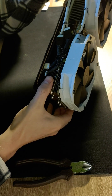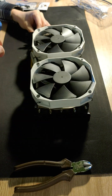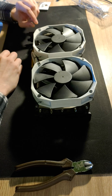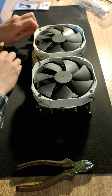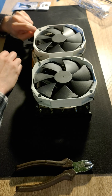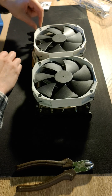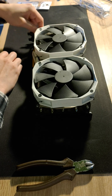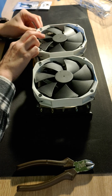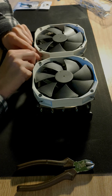I have to remove my Phanteks fan first. As you can see, most fans will fit well there, and in the case of 140mm fans you don't need high pressure — a flow type will be just fine and for sure much more quiet. Before even taking the GPU out of the case, check some disassembly videos of your GPU to be prepared for the wiring and fan header type. Asus, for example, uses a non-standard 7-pin header for fans, so you need a different type of adapter.